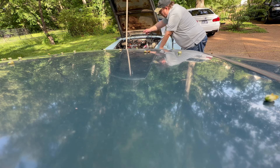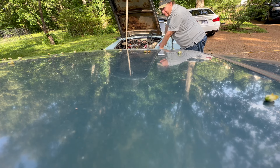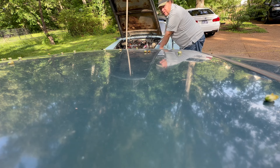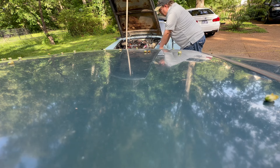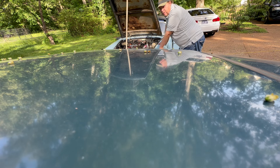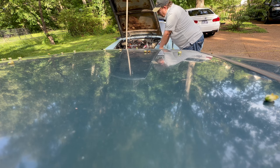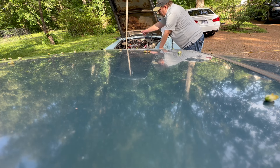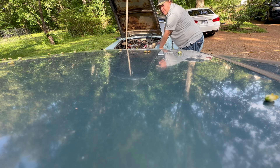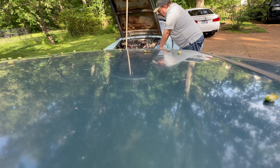I'm going to put the ballast resistor back in. I checked straight from that wire and I don't think it's cutting down to nine volts like it's supposed to, so I'll probably put the ballast resistor back in. When I tested with the ballast resistor the other day, it was cutting it down to nine volts, but I went ahead and tried without it in case those wires were already resistive wires from the factory.